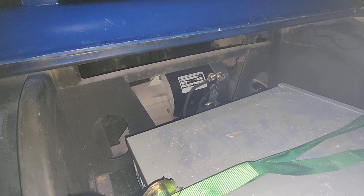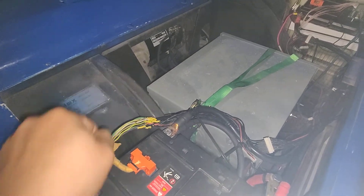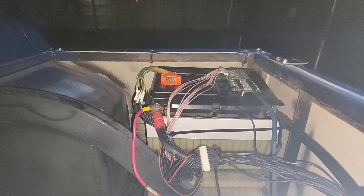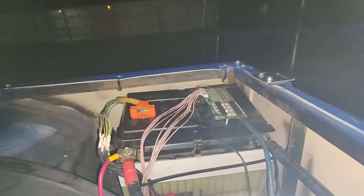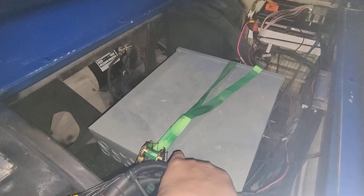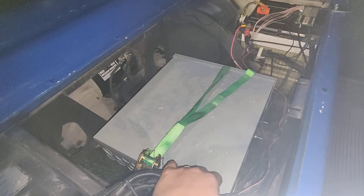You can't really see it well, but there's the new motor — that's an ES1-4002. It is a 36-volt motor, but it is compatible with 48 volts; I made sure of that before I ran it. And there are the batteries — I have everything zip-tied to the front so it's not going to move. All of the individual cells are also parallel with each other on the opposite cell. On top, I have a BMS unit just sitting there, which is not safe — if it touches metal that's bad, it's an exposed circuit board. So I'm waiting on a new one that'll go inside a nice box to keep everything safe.